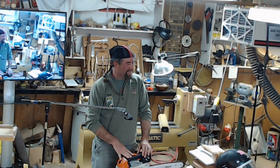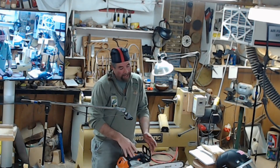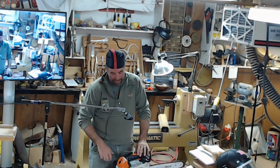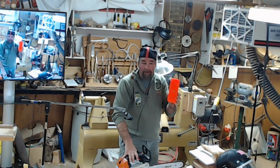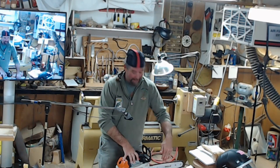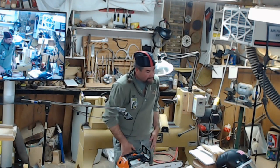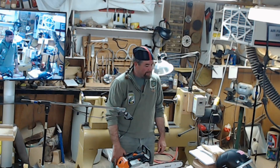And, yeah, it happens. We had another chainsaw. So bring in the other one and then take the tension off of it, cutting on each side of it, and it'll finally eventually loosen up. Or another thing is try to put the wedge in there before it gets pinched, because there might not be any room. If you've got the bar half pinched in it, you're not going to have a way to get a wedge stuck in behind there and open it up. This was a tree that had fallen by the wind, and it was about this high.